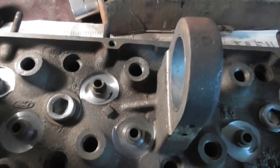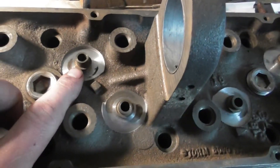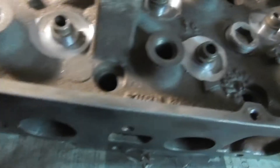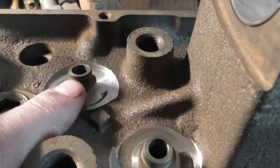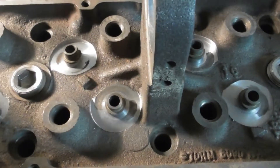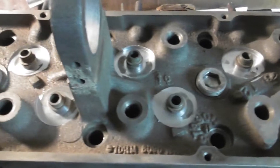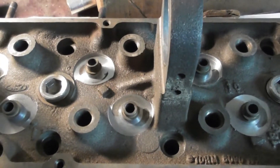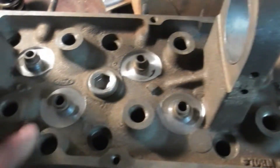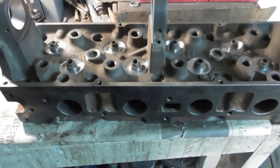Another problem is that the factory seals are a smaller diameter than my cutter, but there is enough meat down here going to use my cutter — the seal will be lower, which will be getting rid of the majority of that top part. I'm just measuring: the stock cam has around 400 lift, and the camshaft that he's going to use in this engine has 528 lift — so that's 128 thousandths difference. So we should be good to go. Seals are on order, probably be here on the weekend, and I cannot do anything until I get those seals.